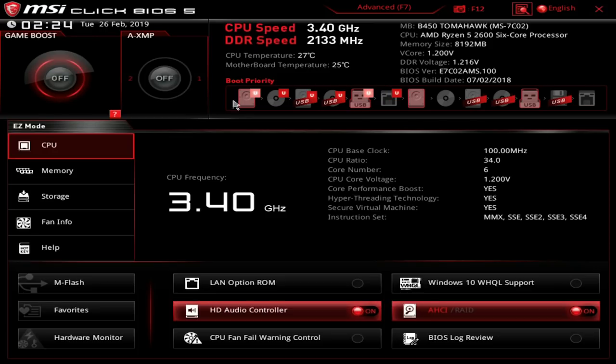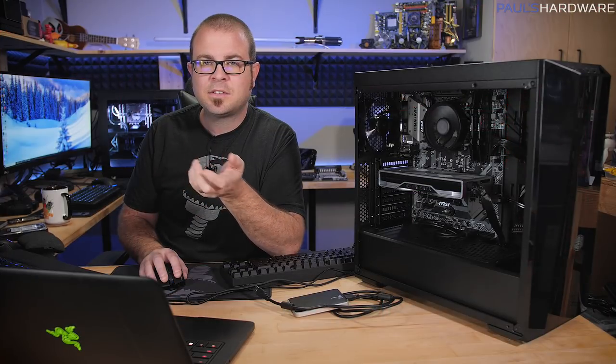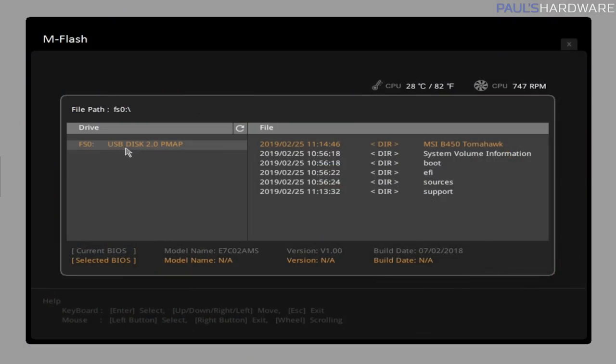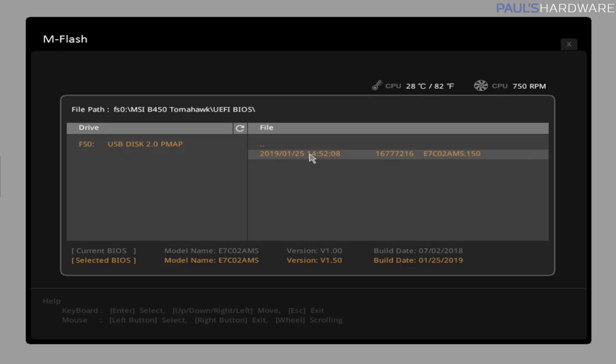So what we're going to do first is update the BIOS. For MSI, there's a utility called mFlash. I can click on mFlash and hit OK, and the system will quickly reboot into BIOS flashing mode. Gigabyte and ASUS have functions that allow you to update the BIOS from within the UEFI — you just need to access the QFlash feature. Double check your motherboard's manual for a walkthrough. Just make sure that if you're updating your system's BIOS, the system stays plugged in and powered on — you don't want to power it off, especially mid-update, as that can potentially brick your motherboard. We've rebooted into mFlash mode, my USB drive is already plugged in. I'll navigate to the BIOS folder and here we can see the file I'm updating to — version 1.5. We're currently on version 1, so I'll click on that, hit OK, and give it a few moments.